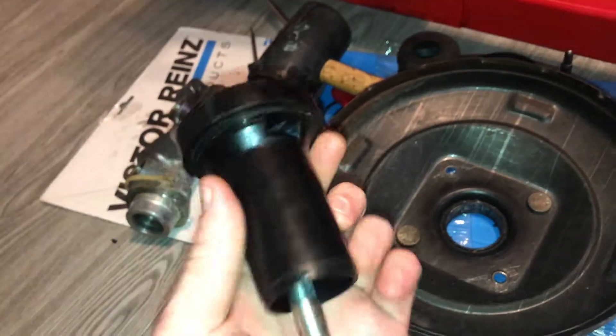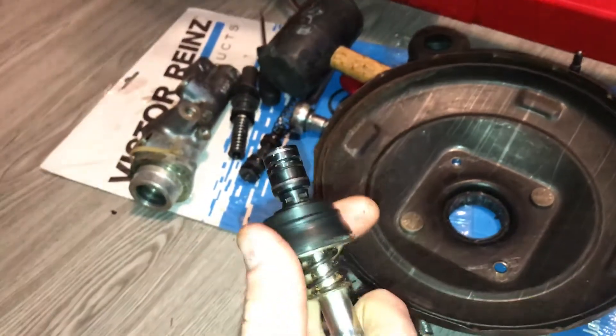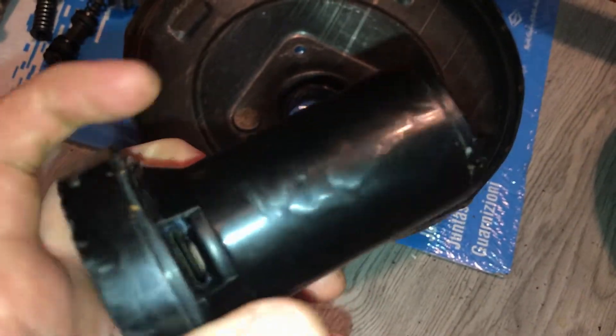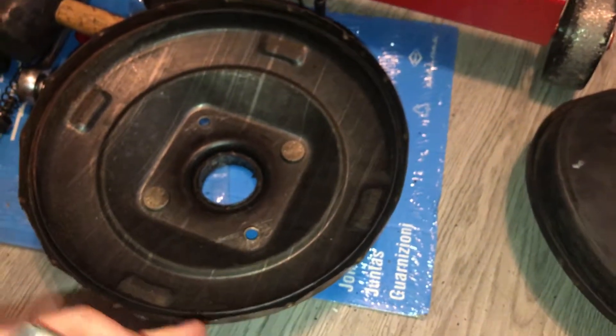So what happens when you push this in? When you push this in and cover one of these and blow, you'll find that it goes nowhere. What's actually happening is, as that little bit of the seal moves forward, it's actually moving up and blocking off these ports. Remember, these ports dump out a little bit ahead. These ports actually empty a little bit behind these. So we're actually blocking off these ports here by moving that seal forward. When that seal goes forward, that means you've pressed your pedal.